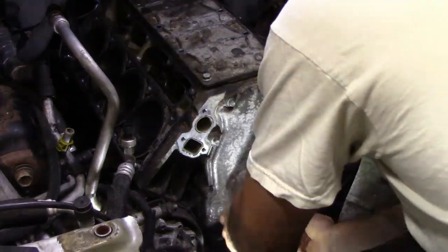and it pushed it right out and through. Now this is actually a Saab 9-3 lower strut bolt, and these are technically not reusable, and these are ones that I just had sitting around. So that's what I used. Crank pulley's off, which is perfect. Now I can pull that front cover off. So let's get on that.